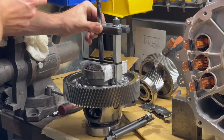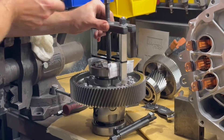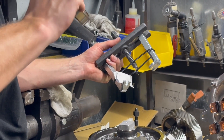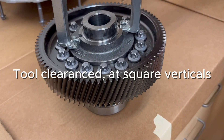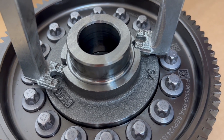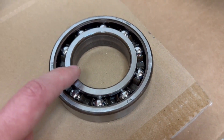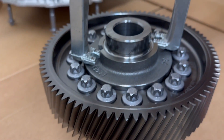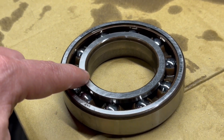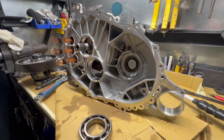That's not a lot of force to take that off — that's encouraging, since it seems impossible to buy another bearing. One unmolested Tesla bearing — looks perfect. The tool we were using may look a little ghetto, but the point is that we were putting the feet right here in those notches. When they go in those notches, they're actually pressing on the center of the bearing, which is appropriate. The identification marks are only on one side, so we know it goes in the same way. We did find one shim, right here on this side.